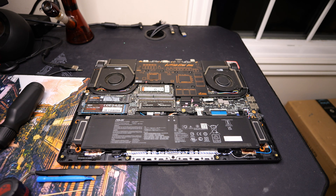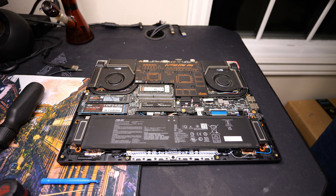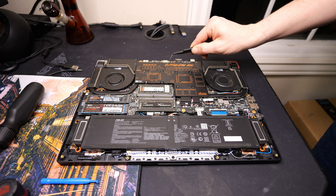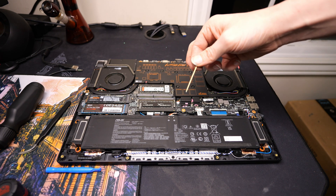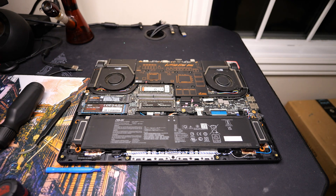Why don't we go ahead and get this thing put back together so we can start it up. Hopefully it still starts — I didn't see any sparks. I never do unhook my battery. I had one bad experience when I was younger where I wasn't careful and broke the connector off, and at that time it wasn't easy to get a battery, so it was just a bad time. As long as you're not messing around with metal, you shouldn't have a problem. The only thing I could see being a problem is if you took metal tweezers and started trying to clean out some of the compound — then it might bridge two connections and spark. Instead, I have a little wooden toothpick. That ain't gonna do nothing. Just be careful not to push so hard that you break any of the little things. I got rid of all of the old putty, all of the thermal pads, so it should have optimum capabilities here. I made sure I put thermal compound on every single one of these chips, so we should be good to go.